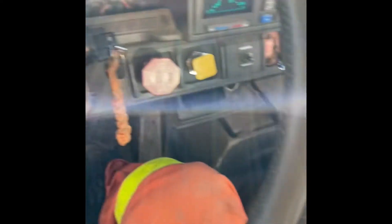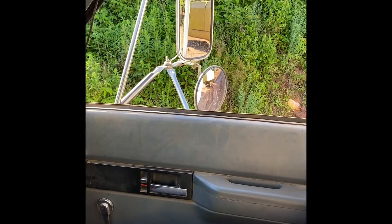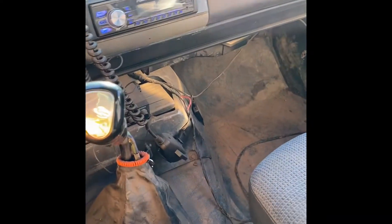That's how you drive a dump truck. Here I'm backed in and being loaded — I backed up to a machine behind me and it's starting to load me. With air brakes, pull on your emergency brake and take your foot off the brake. Just sit in neutral and relax until you're loaded up, then pull away and put her in first gear.